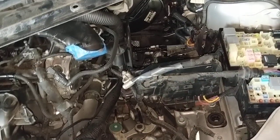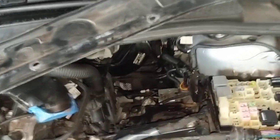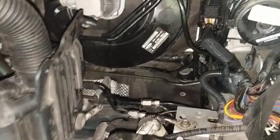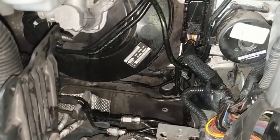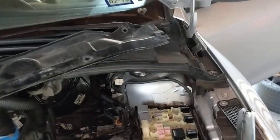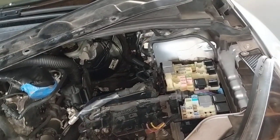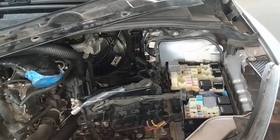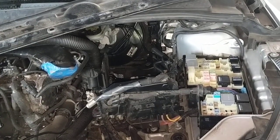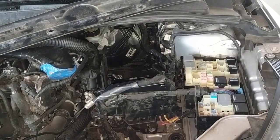Taking out the air box is probably the easiest part — well by far. The battery box isn't too bad either, and there's a little screw that goes into the battery box. All of that is simple, difficulty one out of ten, compared to getting that clip and sensor arranged inside. So that's an idea of what you're going to have to do if you're replacing your master cylinder or clutch pedal assembly. It's a nightmare.